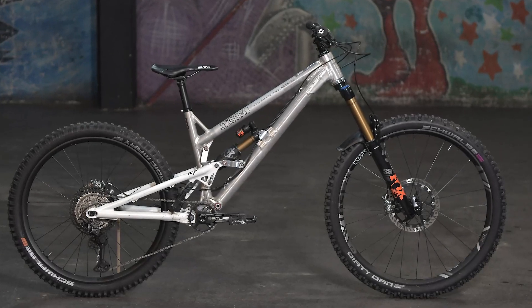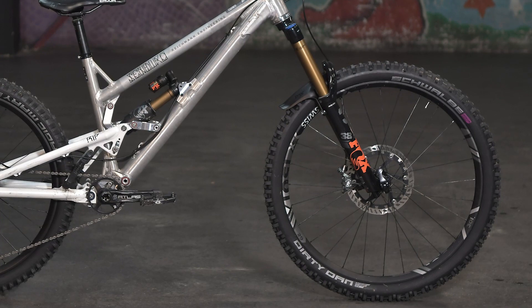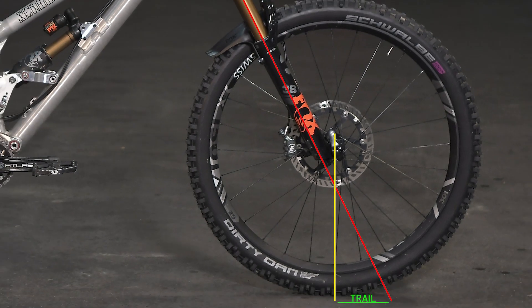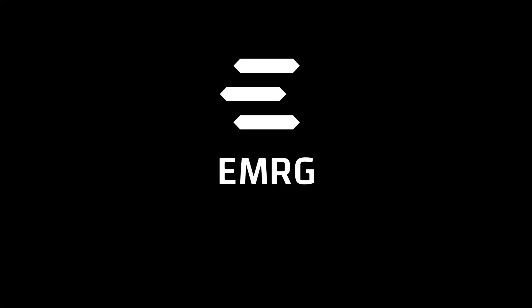The trail results from the imaginary extension of the steering axis and a vertical line from the front wheel axle to the ground, the wheel contact point. The offset is the distance from the fork shaft axis to the front wheel axis. Since we are now moving the fork shaft axis with the Virtual Pivot Headset but the steering axis remains the same, the effective offset changes. The wheel contact point shifts. This shift of the wheel contact point changes the trail.